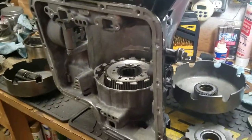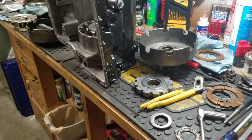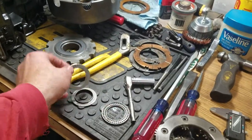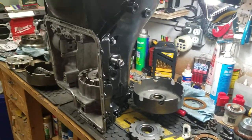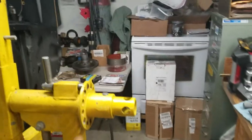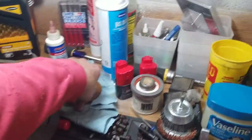But my point is that I'm going to make this thing fully rollerized, and it's going to work perfectly, exactly as I expected. And I'm going to be able to use some of these old pieces from the old transmission to actually get my clearances correct without having to go look for a hard to find selective number one washer right now. And again, here's the old one.